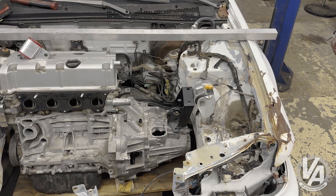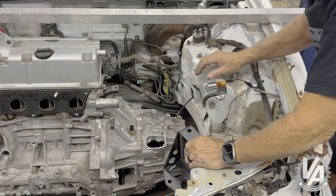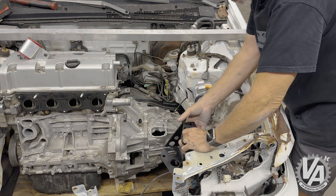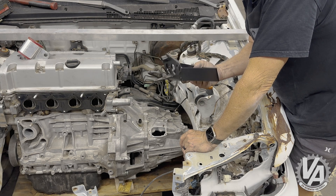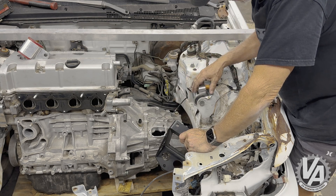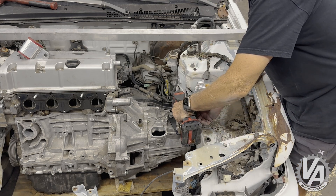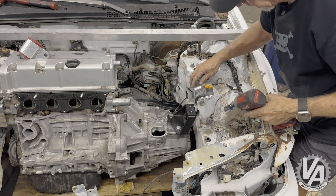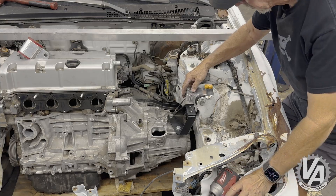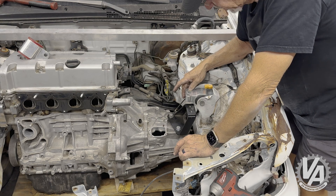This is our block bracket — used to go here. Not even close. I'm not sure how much more we've shifted the motor over in this direction, but regardless it doesn't matter: this isn't going to work. So I'm going to go grab the one from the new Prelude mount kit — again, we have that in software so we can make our adjustments to the drawings. After messing around a little bit in the back I found an EFK bracket that I use for some prototyping. Let's put this in here. This is what we'll be basing our new mount off of — this EFK mount. I have this in software so it's easy enough to modify. I have the information I need; I just need to take a few measurements and start designing.